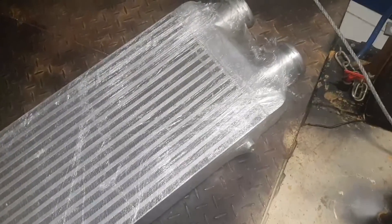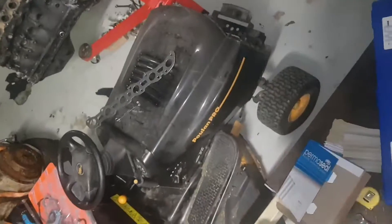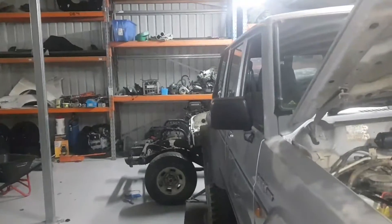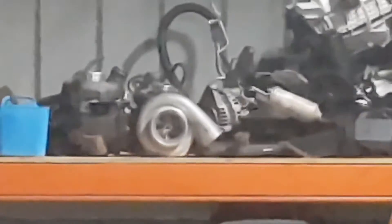Got our new intercooler - it's a return to flow so it goes down the tank and back. I'm going turbo on this. That'll just take out this condenser - no need for aircon - throw it in there, and we're gonna put the 2J turbo on it that we never use. That's the GT3582 - we're gonna slap that on there. We're going away in about two months.